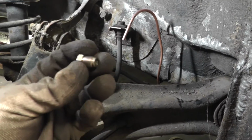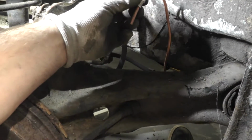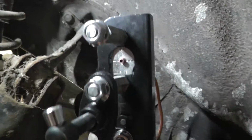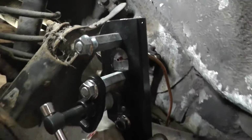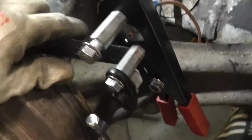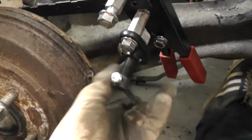This is very important, make sure you put this little connector in here, like so, and tape it up. And then you can, well, here's the tool, you clamp it round, make sure you have a good amount protruding from the end there, and then you get this little forming tool, because we're using 3/16, the smallest one there, you place that in here, like so, and then you just flick this thing on here, like that.